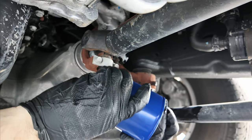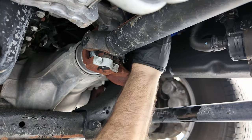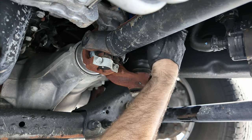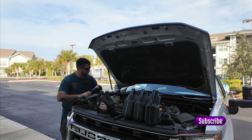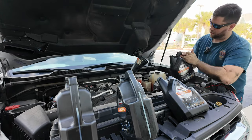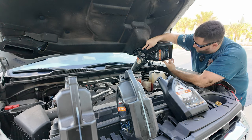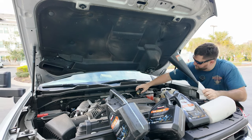Take your new filter, put just a little bit of oil on it, get that gasket all nice and lubed up, and then spin it back on up. No reason to over-torque these — put some good pressure on it but that's it. The L5P is going to take roughly about 10 quarts, depending on how much came out. Funnel — don't forget a clean funnel. This thing drinks it; at least it doesn't burn oil like those 5.3s that Chevy has — those go through like a quart once a month. And don't forget to put your cap back on.